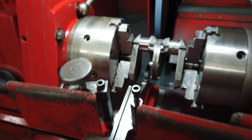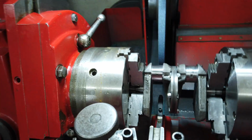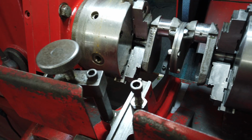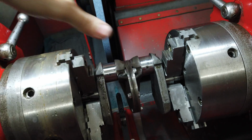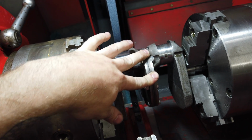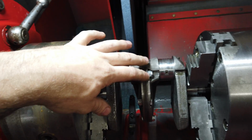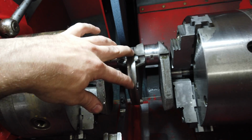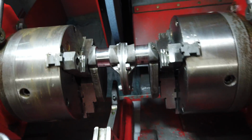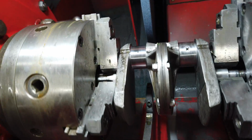So I'm going to zero in the timing side, get it ground, and then it's like 9 o'clock. So tomorrow morning I will come back in, reassemble this with new bolts, and then we will balance it. And we're gonna go with Thunder Engineering rods. So I'm excited about that. It's gonna look really bitchin', so we will get going. But I just want to give a little halfway update on this.